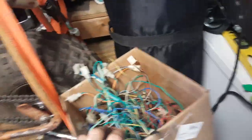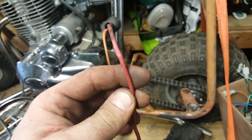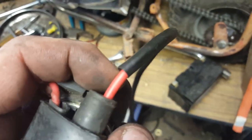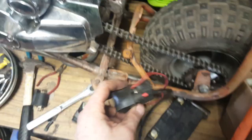This wiring harness is from Chinese choppers, by the way — I used to have one. This starter wire is just inadequate; I don't find it good enough to start a motor, and some of the insulation is a little bit melted, so this wire has definitely been getting hot. We're going to upgrade that to a bigger wire for sure. This other wire here is much bigger and even that I think is inadequate and probably a little bit small, so I might be upgrading both of those wires.